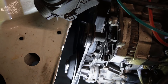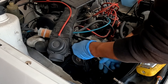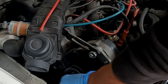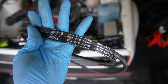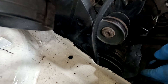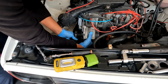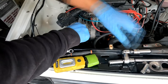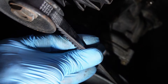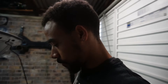Replacing the belt is a very easy job on the Mark 2s because everything is easily accessible — unlike modern vehicles with safety, emissions and comfort technology crammed under the engine bay. All we need to do is loosen a few bolts to take the tension out of the belt without removing any additional components. With the belt slackened we can remove and replace with the new one. If you're struggling to order a replacement, most manufacturers put a part number on the side. Now it's a case of installing everything in reverse — make sure the letters face the right way and check if the belt is directional. Set the tension by moving the alternator up by hand, tighten bolts hand-tight and allow the belt to twist 90 degrees. The new belt has been installed and on the initial start it sounds a lot quieter.